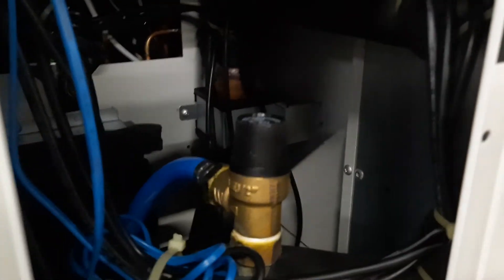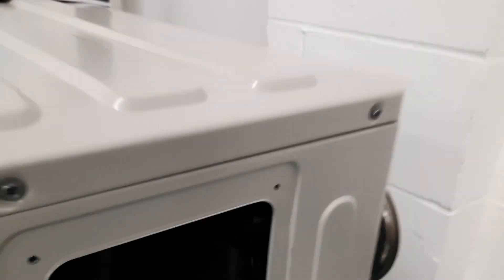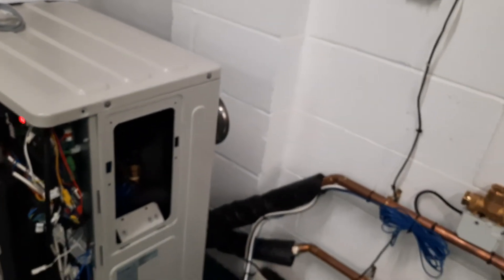On the Midea unit, nice and easy — you can blow the air off with this blow-off valve. Also up here, underneath the little cover, there is actually an AAV. Make sure that's open and all the air is out of the pump.